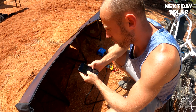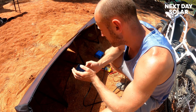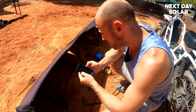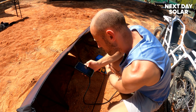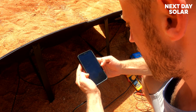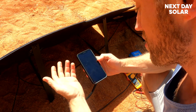Even if you had loads of solar — because you might want more solar than the bike takes — a 480-watt charge, but you might want a kilowatt of solar so on cloudy days it's still charging. We've changed that down. Battery preset: I'm going to select lithium. Basically we're seeing 77 volts come in, not using any current. It's showing the battery at 56 volts because it's got nothing connected to it.